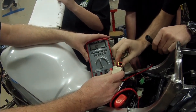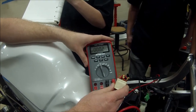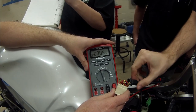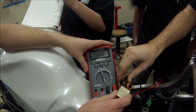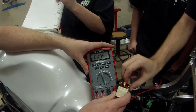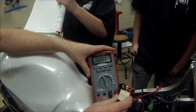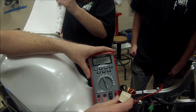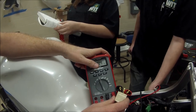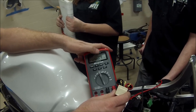All right, we're just going to go one leg to another. Point five, that one's good. Switch it. Those fuses really throw us off on those poor leads, don't they? Yeah. 0.5, now switch the middle one over. So the continuity between all those is good. And even if we went to 0.6, we had 0.1 of resistance in there, we would subtract that from those. So we're good. We're within our specs.